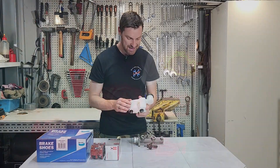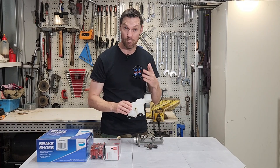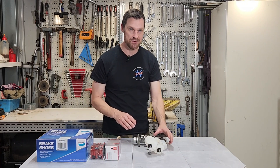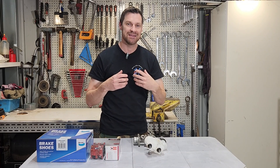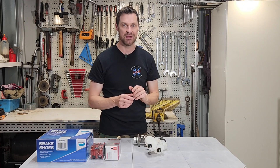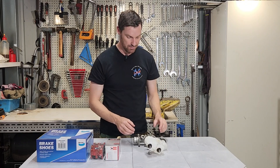When that red brake light comes on the dash, this reservoir is usually the first place to check — do we have low brake fluid, and why? Brake fluid is also hygroscopic, meaning it absorbs water. Moisture will find its way into the braking circuit over time, and if the brakes get really hot, that water will boil off, causing brake fade and a slight drop in fluid level.